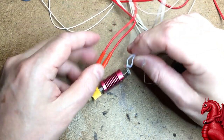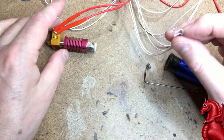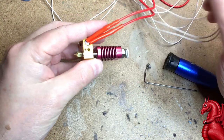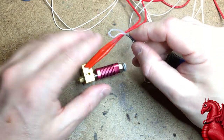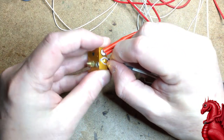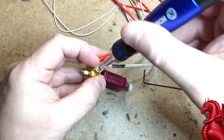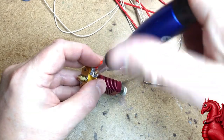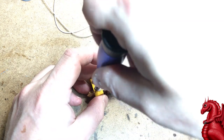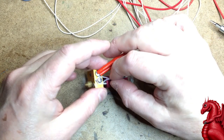Remove the retaining screw and you can see the thermistor — it's just a small glass bead, very fragile, and the wiring is super thin and can break easily. When you put the new thermistor in, insert it so that the entire glass bead assembly is seated up in the hole. Bend the wires over, then put the retaining screw back on, making sure both wires are underneath the screw. Turn it until it's barely touching those wires and stop — that's all it needs to keep it from backing out.